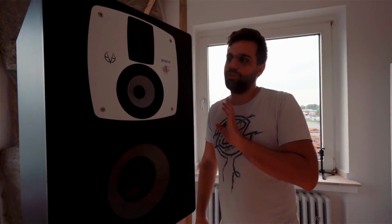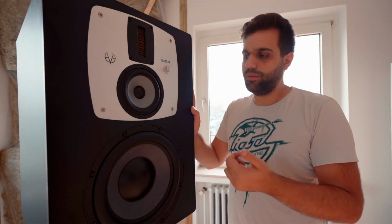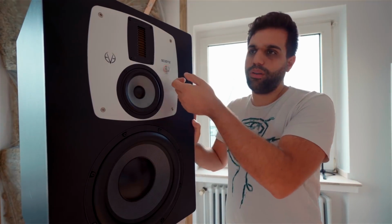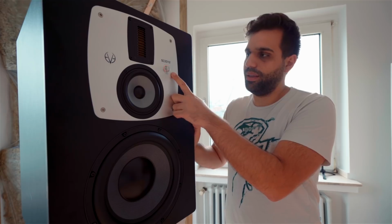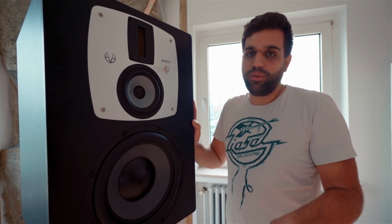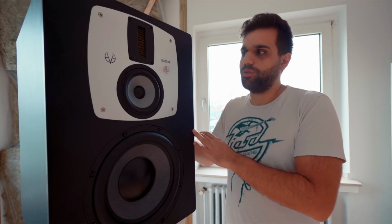And then also most speakers let you tweak them. Some have a digital EQ where you can kind of match it and try to get more bass, less bass. Most systems have a knob where you can adjust the treble, bass and high frequencies. Here as well, I can emphasize the bass by 3 dB, lower it by 3 dB. So checking out these settings might be something that will give you more bass if you're interested in that. Some speakers have it on the back, especially studio speakers. On home listening speakers, you might find it in the front or in the settings.